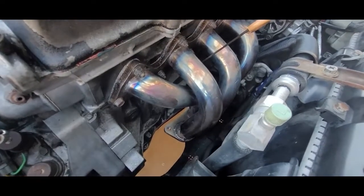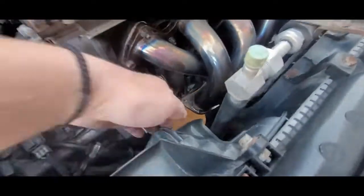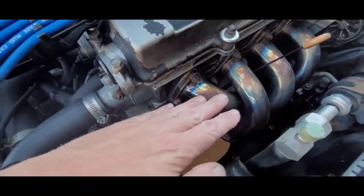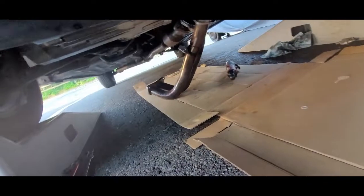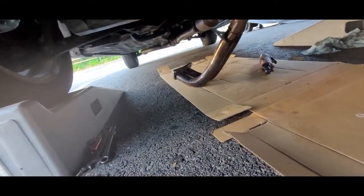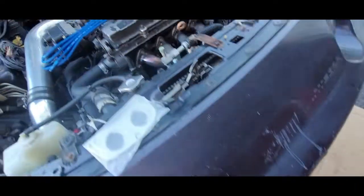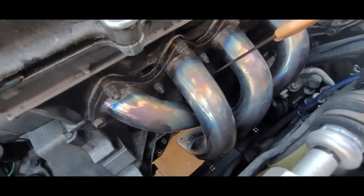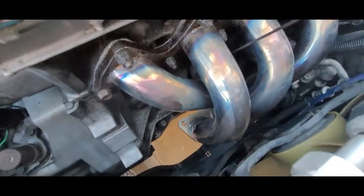You can see by holding them up that these connections here, when this was flipped over, the surface was not flat. Same with the surface on the pipe there. So I took my grinder, I made them as flat as I could, and I used the gasket that they sent me with the kit, but it failed.